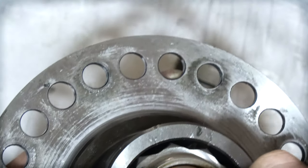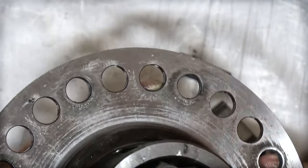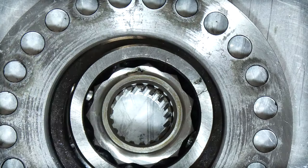The only downside is that if you apply mid-corner throttle it goes to full lock, so the car will tend to be pushy in the corners if you're not driving to the differential you've got installed in the car.